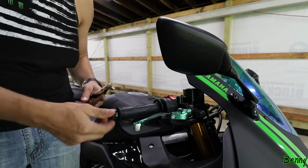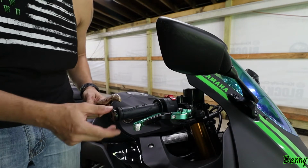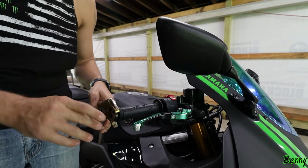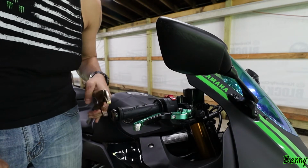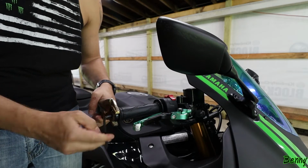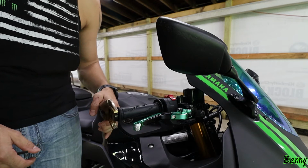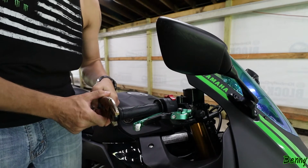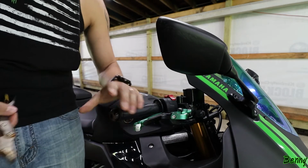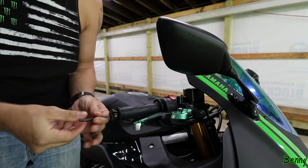I put them right on the bar end because I don't care about these bar ends. They're already damaged. You can see there's already rust and everything on them. They've already been dropped a couple times. So I'm just clamping these right on. But when I go to put the new bar ends on, I'm going to have to wrap a towel around it or whatever to tighten it up. But I didn't even snap these on. I just held it with some pressure. And the nut cracked real easy. It's coming off real easy. Same thing with the other side. I went over just to test it. I didn't have to put any force on this and really clamp it in. I just put a little bit of pressure to hold it from spinning. You probably could do it with your hands if you're strong enough. But anyway, that's how we're going to get that off. And then it should just come right off.